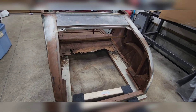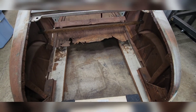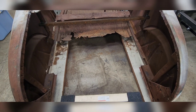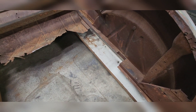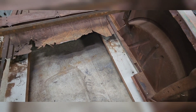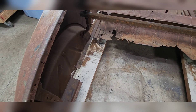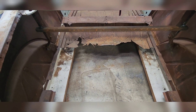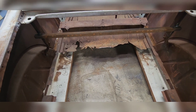I managed to get some time over Christmas break to get out here and measure off and cut out the rear floor. We had to cut out the area on the sub rails where it would normally mount to the frame, and along the outer sub rail to accommodate the step in the frame. Once we get this on the chassis, we'll box this all back in and put a floor in, and it'll look nice.